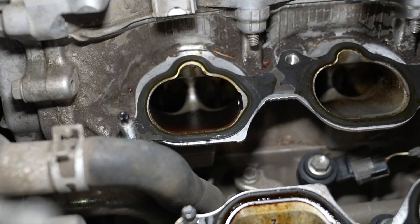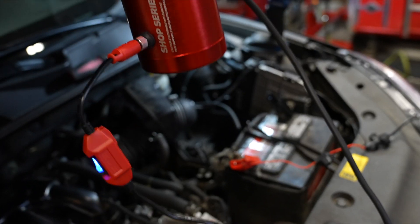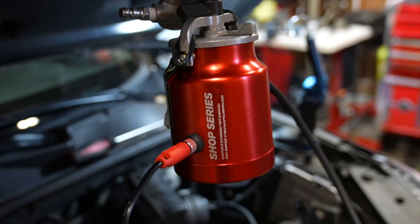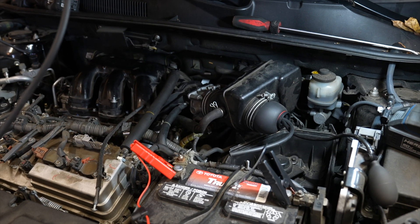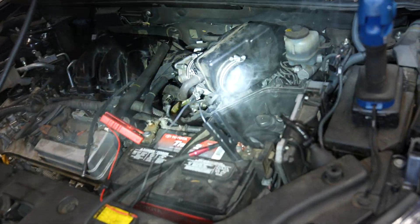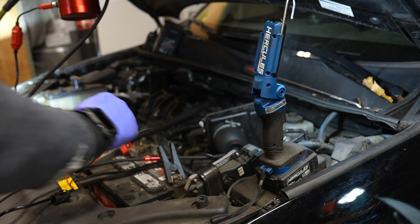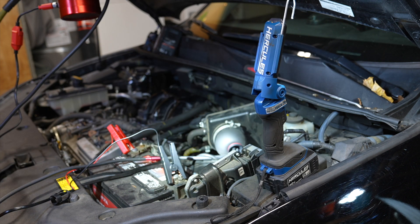Unfortunately I also found a bulging coolant line. What we've got to do is heat up the coil before hooking up the air so we're not filling up the whole garage with stinky burning baby oil. We have the bladder in there and we're ready to retest. We've pumped a ton of smoke into that intake manifold. Now turn the coils off because you don't want to keep making smoke — it's super stinky. Pump it back up to pressurize the system again. A better tip: when all the smoke is inside the intake manifold, turn off the burning coils and just pump air into the system so you don't have belching burning baby oil smoke coming out.